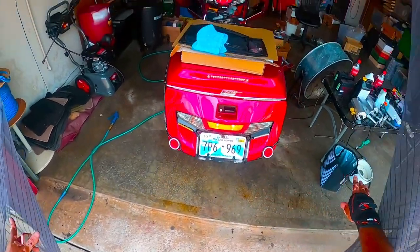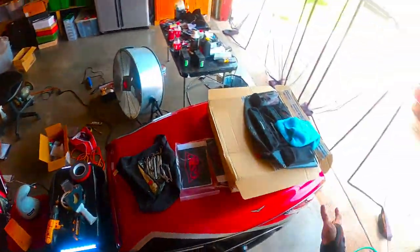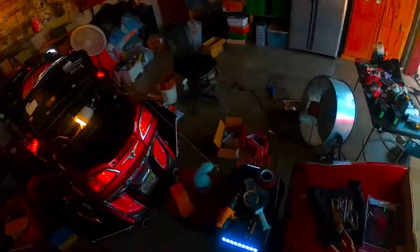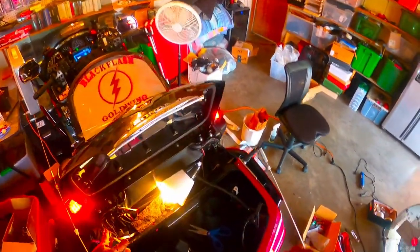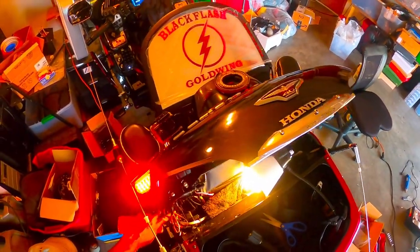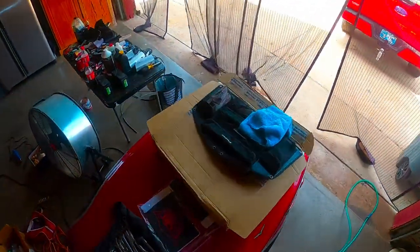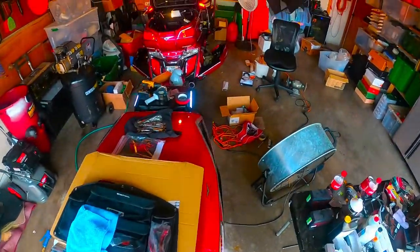Including the brake lights. So if you came across this issue where your trailer lights are not coming on, you've changed out your bulbs, you've gone through your wiring harness and nothing is working, then come up here and check the wiring harness that's up under your lid cover by the hinges. 9 times out of 10, the hinges have cut into the wiring harness. And if the brown wire is cut, that is your brake lights coming to the back for the trailer. The lights will not come on.